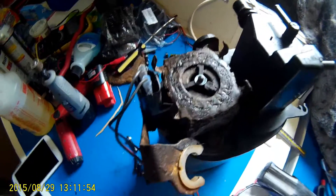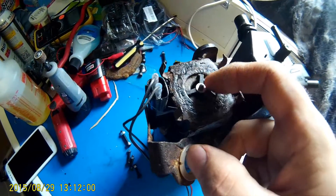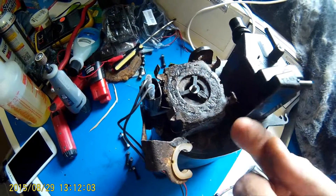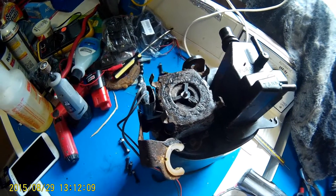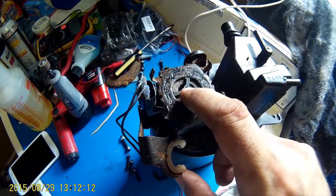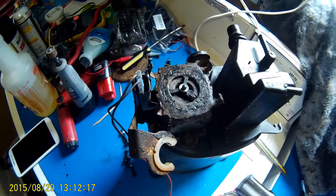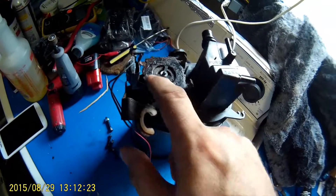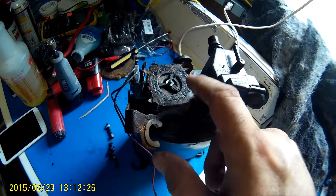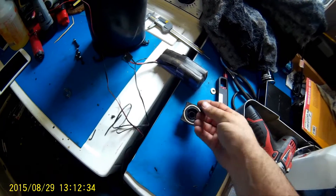What I did was put a little spacer in here. This little silver piece is not supposed to be there, but it's just making this a little bit taller — shimming it about a couple thousandths. Now I can finally get a good seal just with this alone. I still want to clean up this area a little bit better and try to get it sealed a little better, but my problem was between these two parts — I have a height problem.